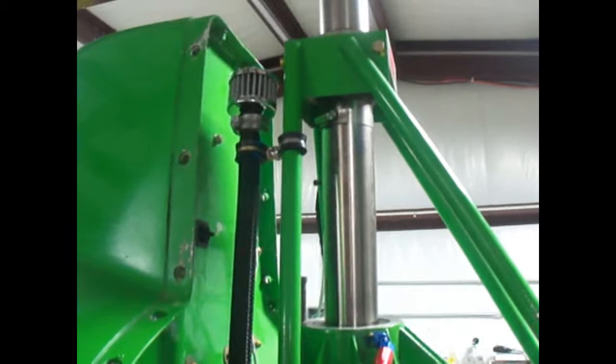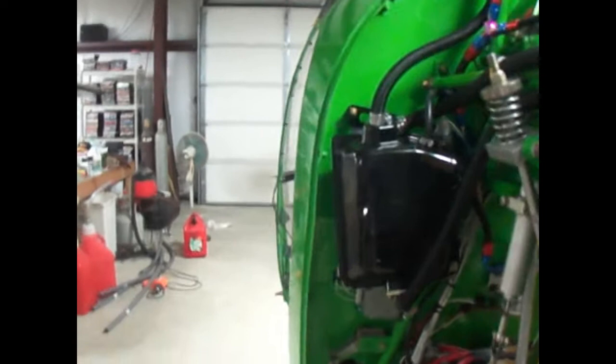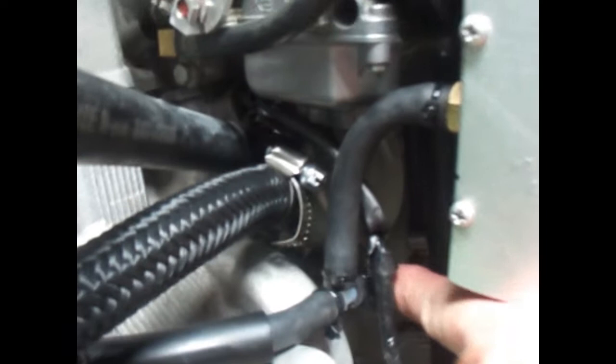This engine has a vent screen up here, and it also has the vacuum port here that vents out of the crankcase. This tube up under here vents the head and the water pump, and it has to have vacuum to vent it properly. That's why I was venting out of here and down through some fuel filters — you could see them in some of my videos with hoses coming out — and I was just getting oil blown everywhere.